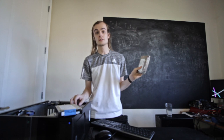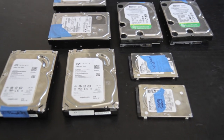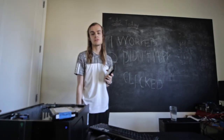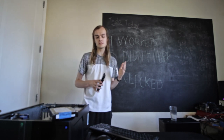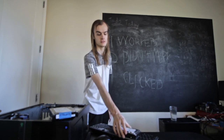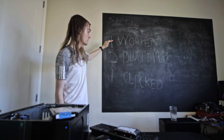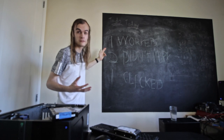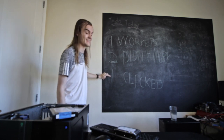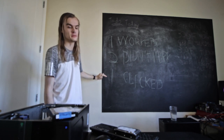So for this model of Seagate video hard drive — the ST2000VM003 — you can't swap boards between drives. That's all the tests for today. Out of four pairs: one drive completely worked with the board switch, two spun up and seemed to try reading but couldn't finish initializing, and one clicked — which probably isn't good long-term and could potentially cause damage.